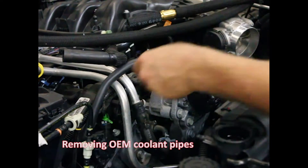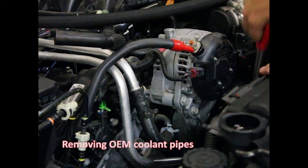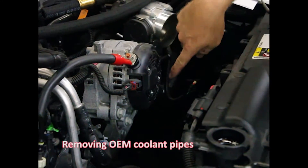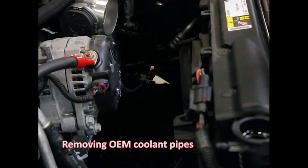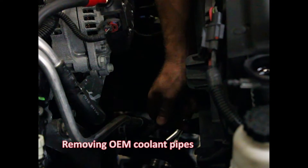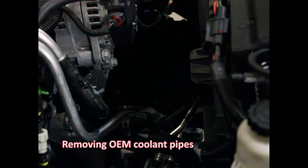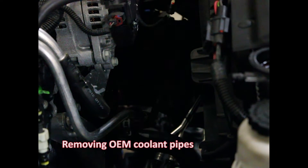The end result is you just want to take them off. So on the top one here, we're going to do the upper on the pipe down here, leaving the hose attached but taking the upper pipe off. This one is a little easier to get with this tool — reach down here, stick it on there, give it a squeeze. Watch your fingers — when these things come off, they'll whack you in the thumb and it won't feel good.